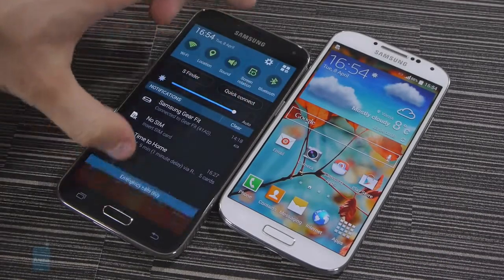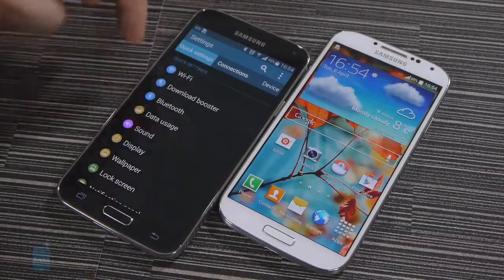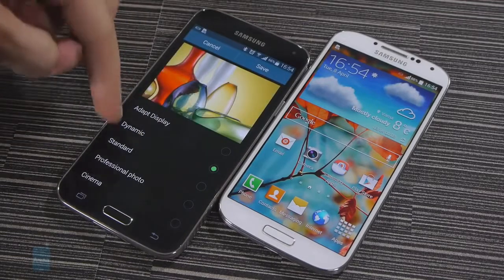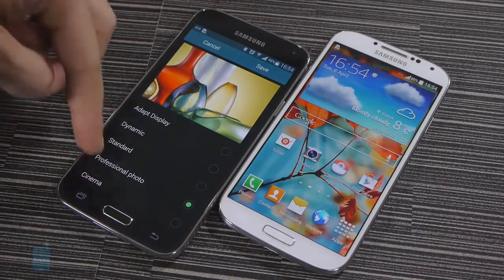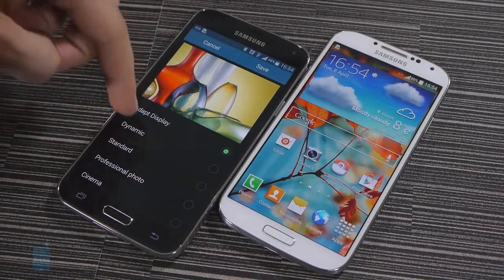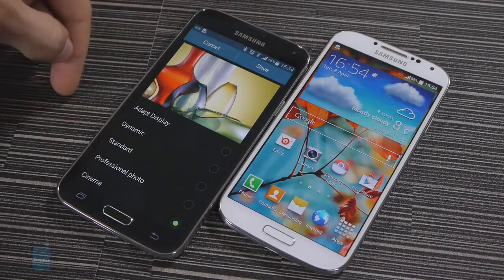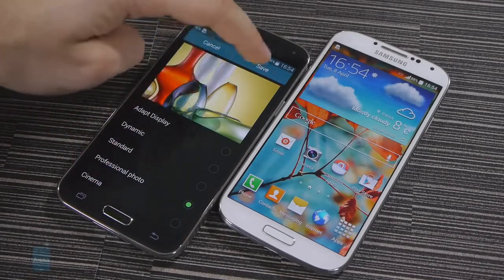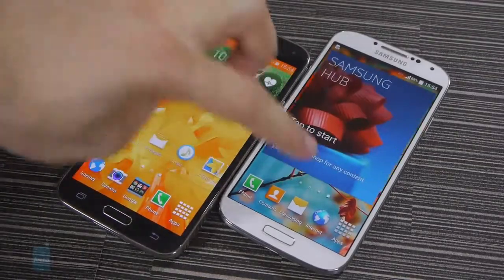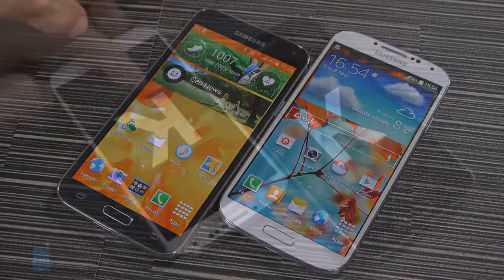Speaking of the Galaxy S5, Samsung continues the trend with wild and unrealistic colors that we saw on the S4. In standard mode, colors on the S5 appear noticeably cold and greenish, and the color temperature hits nearly 8000K, way above the 6500K gold standard. In professional photo mode, colors appear better tempered with a slightly colder than perfect color temperature, and still the display gives preference to colder blue and green tonalities, and it's not very accurate, but it's a bit better on the S5 than on the S4.